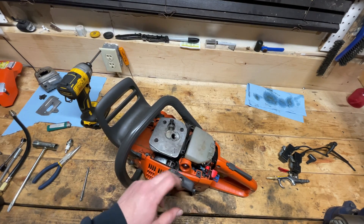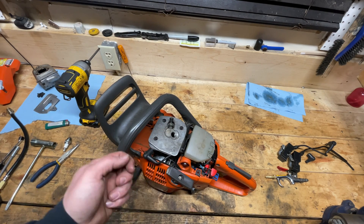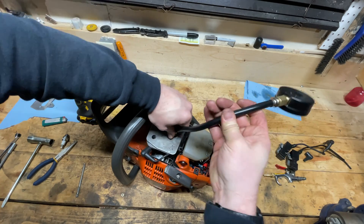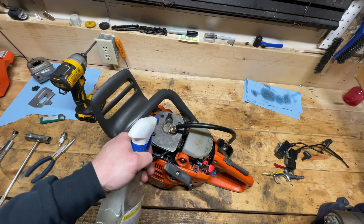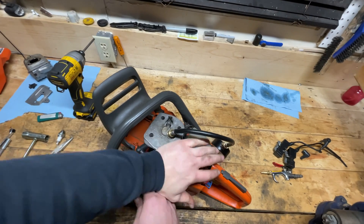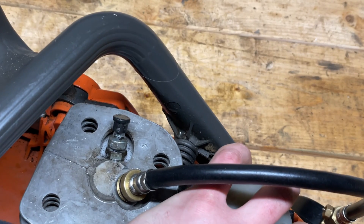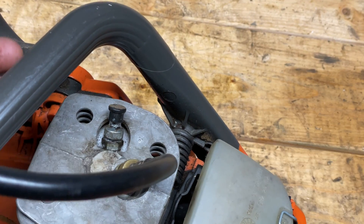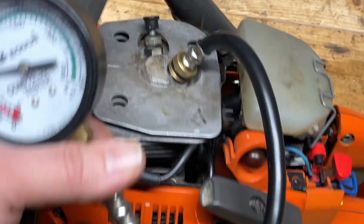Before I call my friend and tell him this piston and cylinder needs to be replaced, there's one other source of error I'd like to check — the decompression valve. Sometimes you can get a leak through there and when you're pulling it over you don't get the same amount of compression. I'll throw my compression tester back in, get some soap and spray it on the valve to see if it bubbles. I use an industrial cleaner bottle with dish soap. I still don't see it bubbling — not losing compression there. I did it again and still got 80 PSI. So I think this piston and cylinder is worse for wear and it's time to put a new one in.